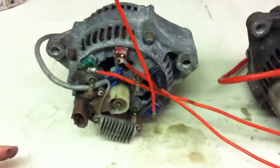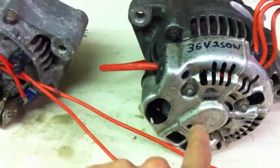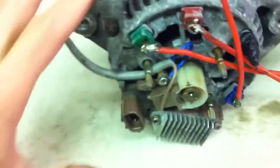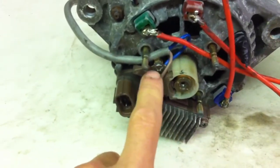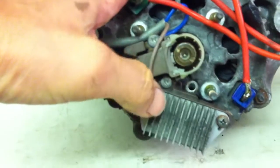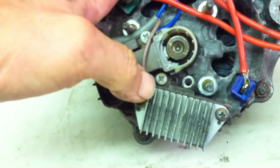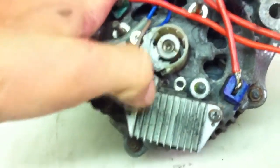On the back side, here's the conversion. I'm going to leave that cover on because it holds the brush holder. The brush holder has got two terminals — one here and one under there — and there's a screw. All you need to do is connect two wires there. I didn't do this the first time.